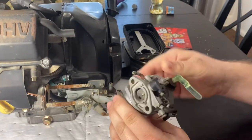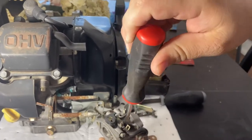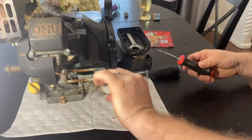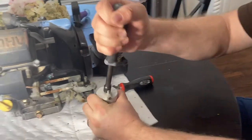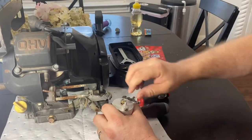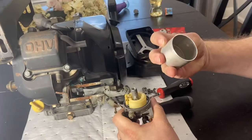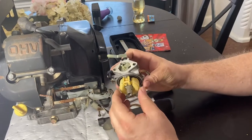So if you're going to clean this, what I would do is use a flat head screwdriver and take your jet out on the top — pilot jet. Then another 10 millimeter to take the bowl off. This will probably be full of gas if you've been using it. Pretty clean in there actually. And then here's your float.